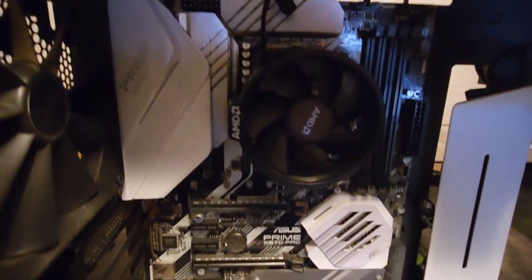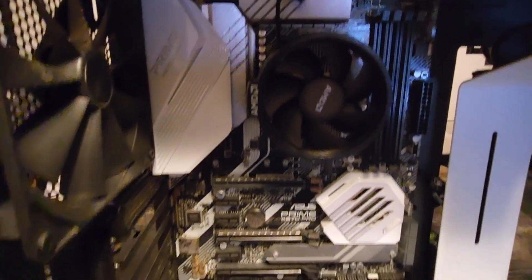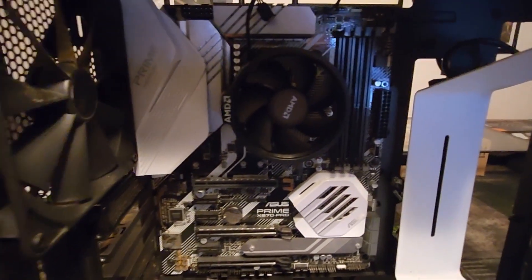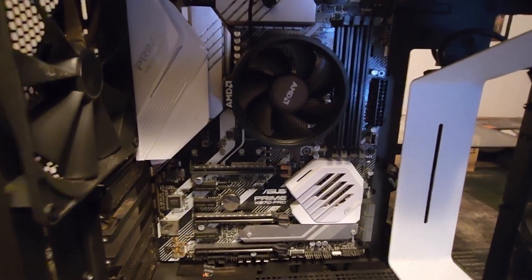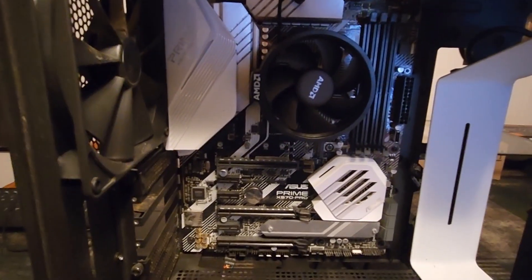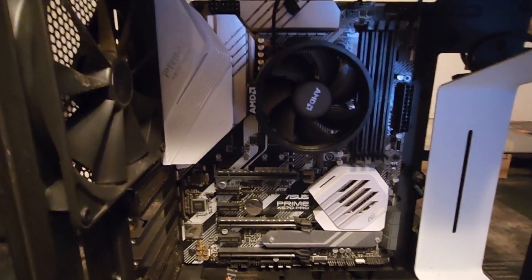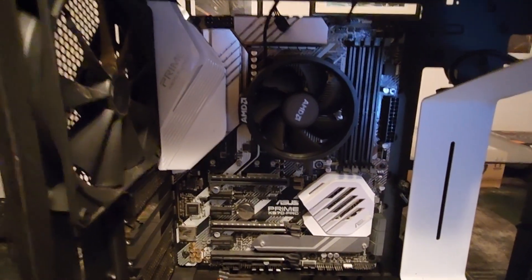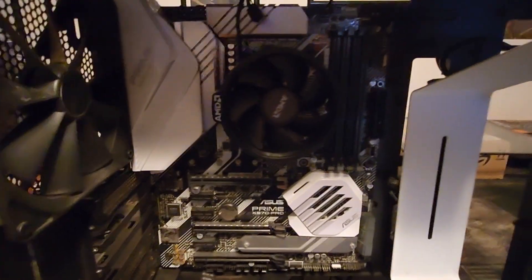I have the motherboard and CPU screwed in, so I want to take this time to explain the motherboard, CPU, and cooler and why I chose them. I chose a Ryzen 5 3600. One of the things I was looking at when mapping out this build was: what is the cheapest AM4 or Intel socket that supports PCIe Gen 4? The 3600 actually supports Gen 4, and that's one of the big things you need in a CPU right now, especially with my target of 1440p gaming.